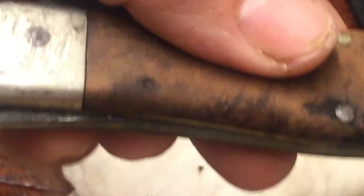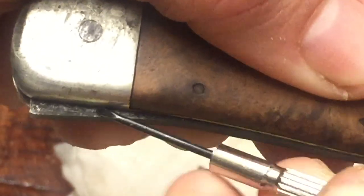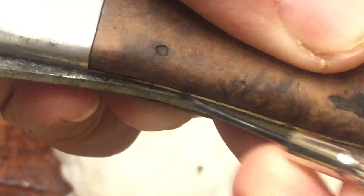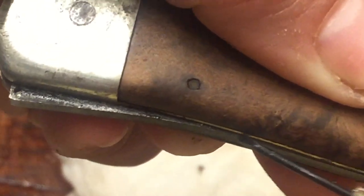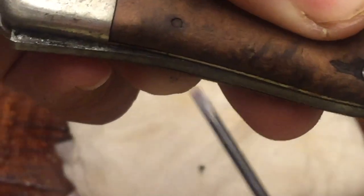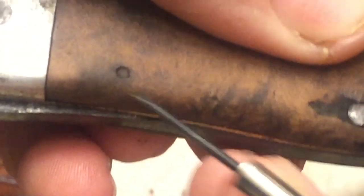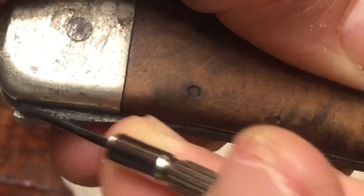After we do this scraping, I'm going to spray it with WD-40. What that's going to do is get all that moisture out of there, and besides the moisture, it's also going to get some of this residual rust, pocket lint, and gook that's in there. That'll make it close a little better, make it a little cleaner — and besides, why do you want somebody's hundred-year-old pocket lint in there?